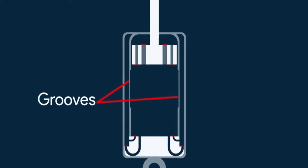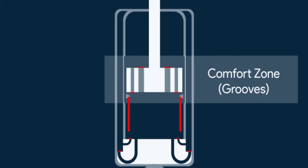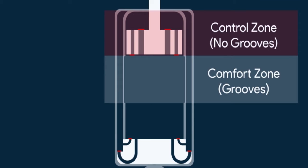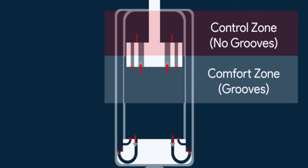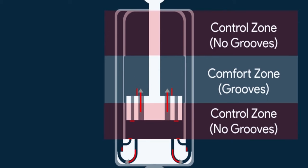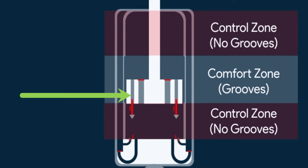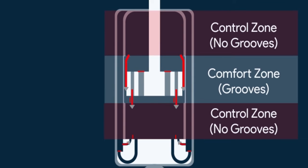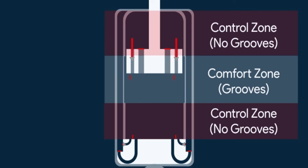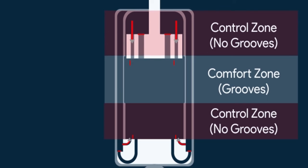The pressure cylinder has grooves on the walls for some length. When the piston is in this region, it doesn't seal off with the walls, allowing the oil to flow through the grooves, easing the travel. For anything above the grooves, the piston seals with the walls and separates these portions well, so piston travel becomes resistant. At compression, there is little resistance in the upper region. Then in the region with grooves, oil gets more paths to travel through the grooves, so resistance lowers even more. Then there is again the region with no grooves, so resistance increases slightly. For the rebound stroke, when the piston is in the upper region, the piston faces a lot of resistance to travel back, as oil has only the valves to allow flow. As it comes to the grooved region, the oil can also flow from the grooves, so there is less resistance, making rebounding quicker and requiring less energy. Then in the lower region, rebound becomes more resistant as the piston seals off better and there are no grooves to further help oil flow.